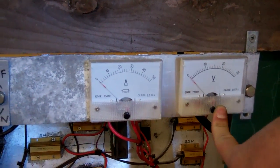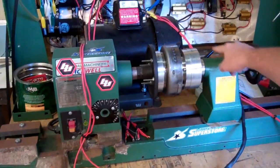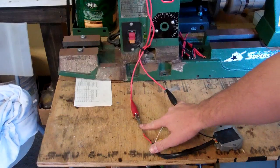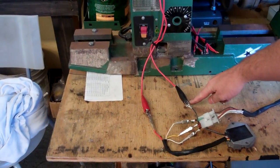So what we're going to do is go ahead and test this regulator rectifier. We have it hooked up with some jumpers right now to the three-phase output of this KLR stator. Here's our input right here — three wires, three-phase input from the stator. And then we have our DC output from the regulator: battery plus, battery minus.